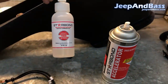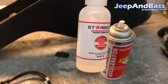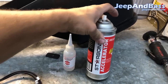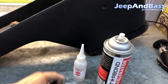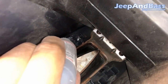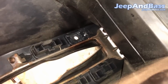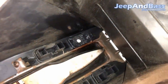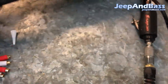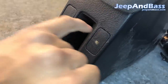With your piece prepped and ready to glue, use some of this stuff — this is Starbond, a clear thick CA glue. This is its activator. Put a dab or two of the CA glue in there, then hit it with the activator and it'll harden up immediately. I'll put a couple of tacks in first to make sure it's secure, and then finally put a bead around and let it set. Wipe off the residual accelerator — spray both sides if you can.